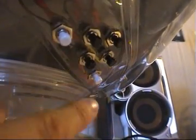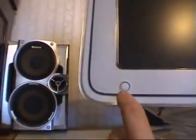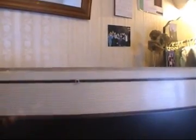So yeah, I've mounted under here a set of buttons for the LCD screen. So you've got a menu button, and then down, up, right, left, and the auto button. Okay, so the 6 standard LCD buttons, just patched and mounted down there. Also, the side has a reset switch. Left hand side was used to be the brightness for the Mac, it's now the on-off for the LCD screen. And this side is the on-off for the power here. I have also added a mic in the hole there. Drilled a hole and then sanded it out, to make it look nice. Doesn't stand out too much, looks pretty cool.